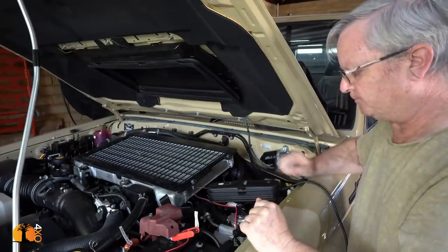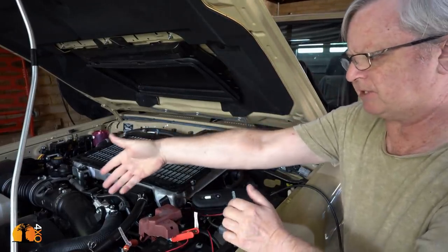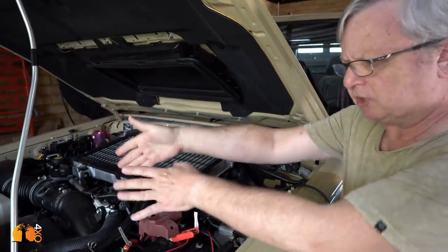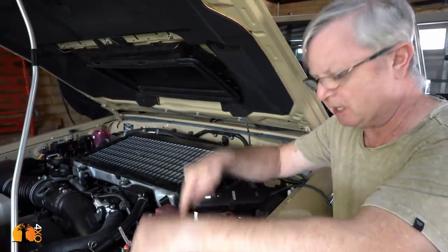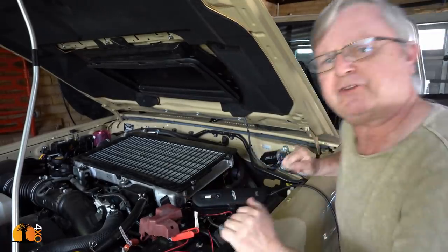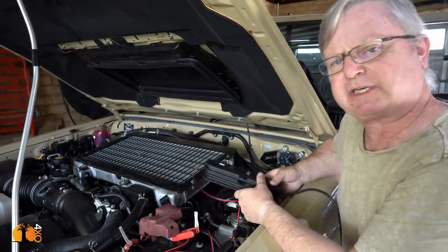Here's the problem. That's a 10 amp charger. That's a 50 amp charger. The alternator is about a 170 amp charger. So with the alternator it's not a problem, because it's charging this battery at up to 170 amps and the DC to DC is charging that at a lower amperage, say 50 amps. But this is 10 and that's 50 — so what's going to happen?